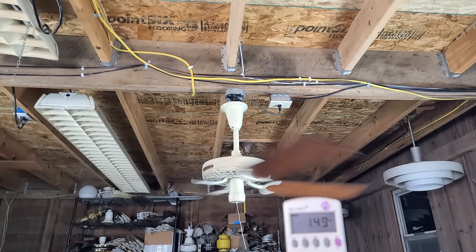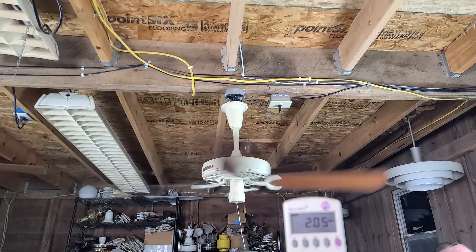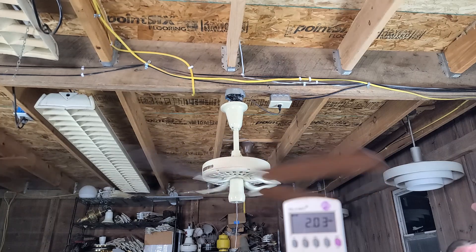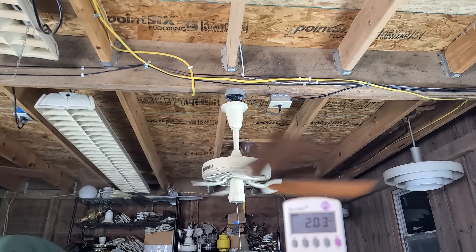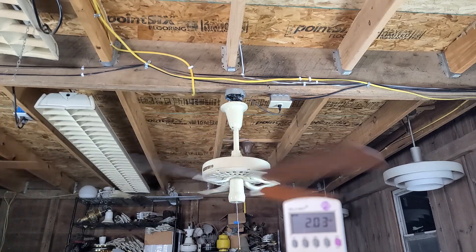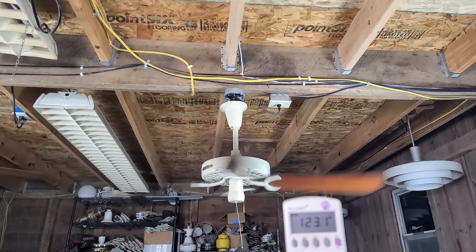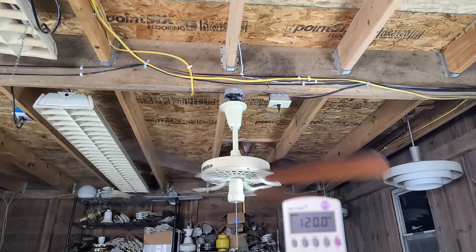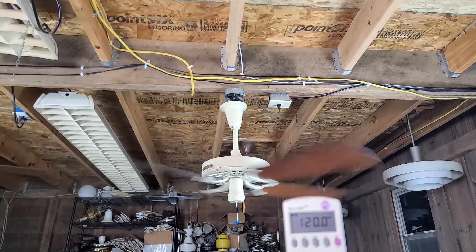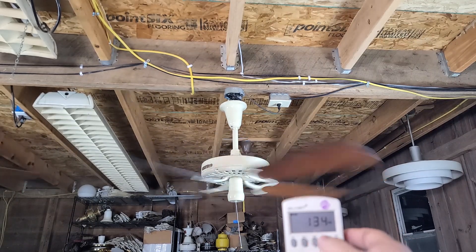The leveler is fun — I love levelers, too bad they're not super reliable. This one was almost partially broken. It's always a good idea to lubricate them with a little oil or WD-40 to prevent breaking. Let me check the line voltage because we're a little on the high side. Right at two amps on this one, which is a little higher — it's rated at 1.9, right?